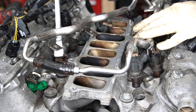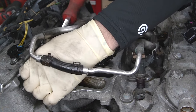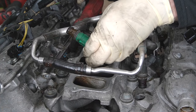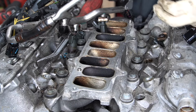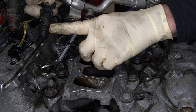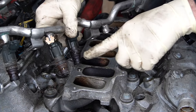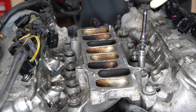There's like a piece of acorn or something in there — no wonder this thing may or may not have ran right. Holy cow, it's full of crud. There was also one injector where the seal is just destroyed, and this one too — no better. Let's get our lower manifold piece off.